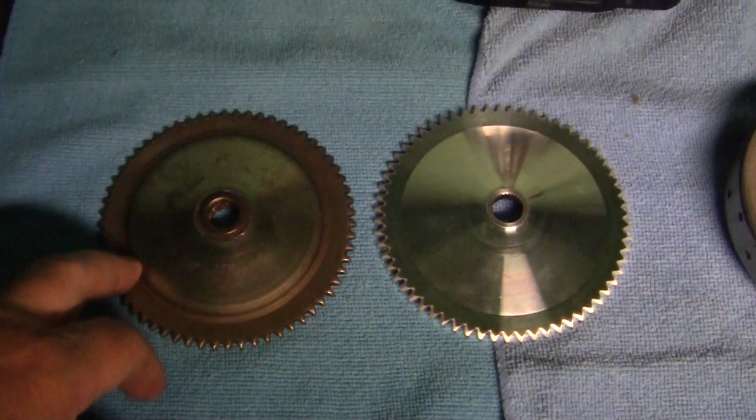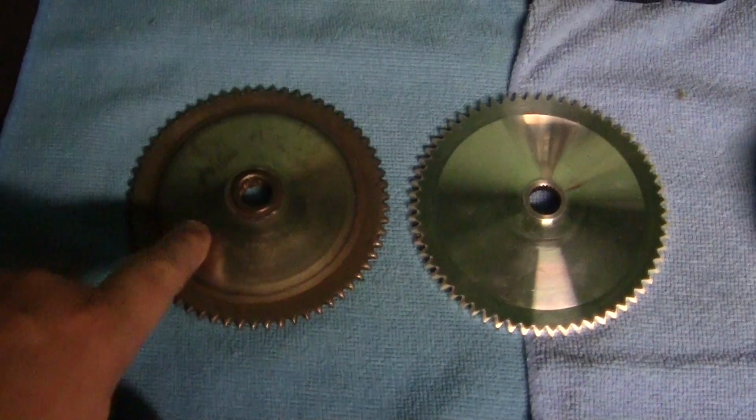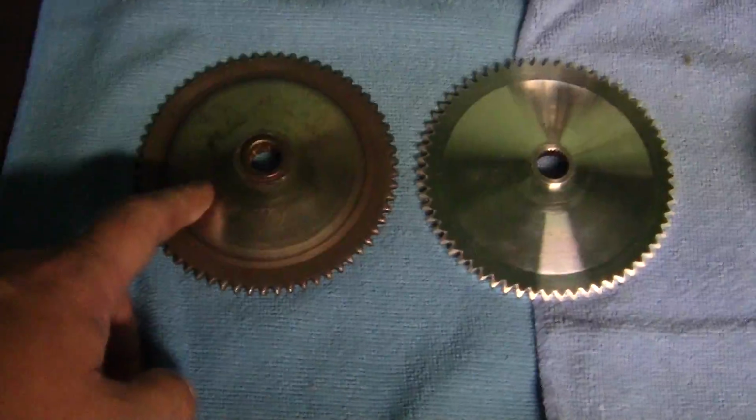Now, generally, when I take off my front ends, my drive faces, I'll take some real fine grit sandpaper and clean this up, and clean up these little scratches. And they're not scratches. All they are is a little bit of asbestos from the clutch right here.